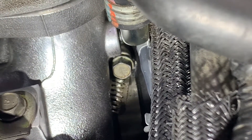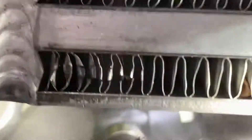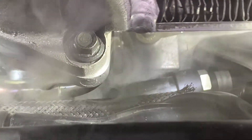Now do the smoke. It's the turbo inlet pipe — it is leaking. The clamp cannot tighten it off. It needs a new turbo inlet tube.